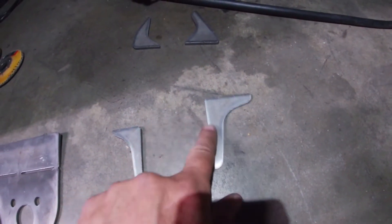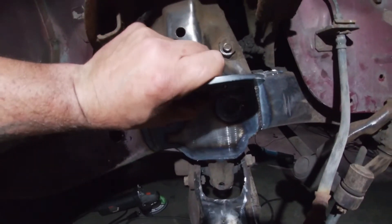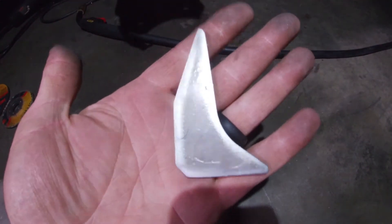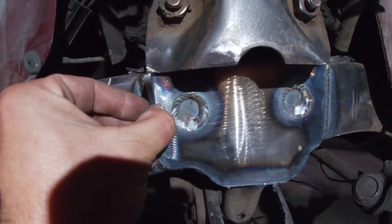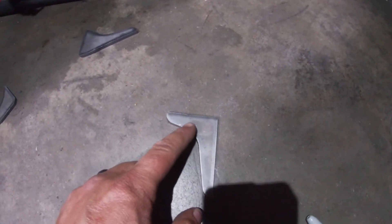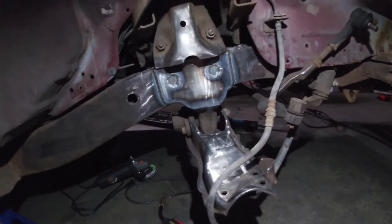The gussets you will be using come with the kit also, so there will be two of all of this stuff. That plate right there — these two right here are for the lower portion, underneath this bracket. And these two odd-shaped ones right here go on the top. They're pretty self-explanatory on the gussets — you just put them in to fit. You just put the 90 on it, just like that — front one, boom, just set that. You may have to trim part of this gusset out a little bit so your bag doesn't rub on it, depending on the bag you choose to run in the front.